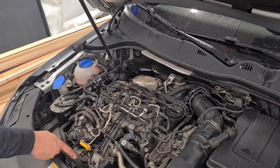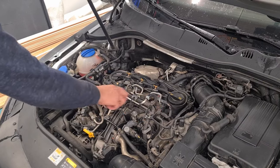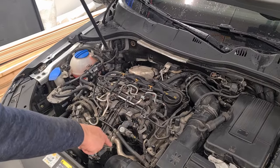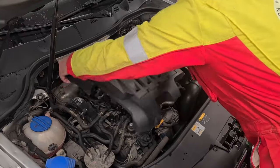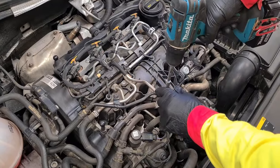We will need to remove the intake hose, some fuel lines, fuel ramp, maybe the injector fuel lines, the EGR feed pipe, and all the stuff above the intake manifold. Start removing all of the pipes, hoses, and sensors located above the intake manifold.